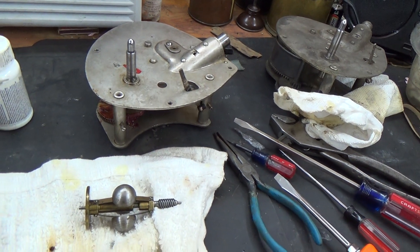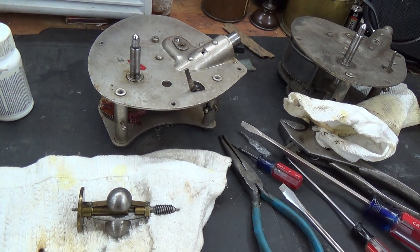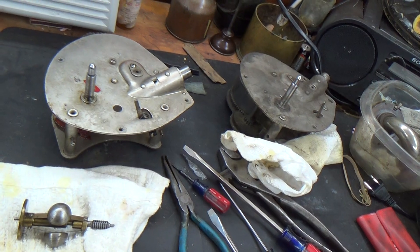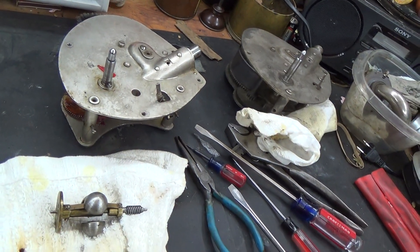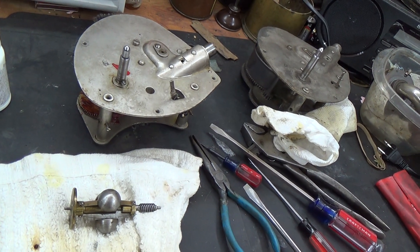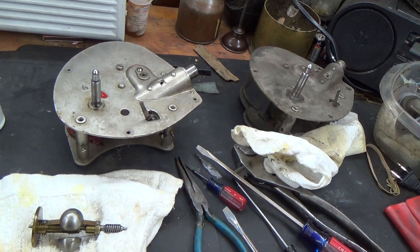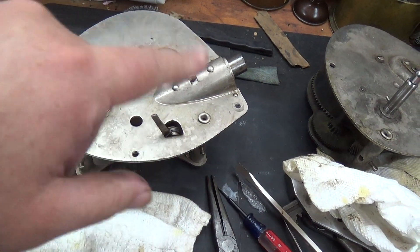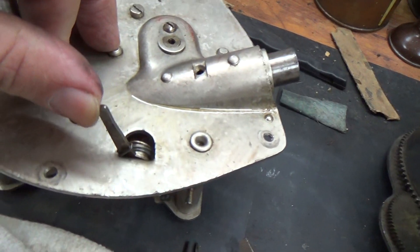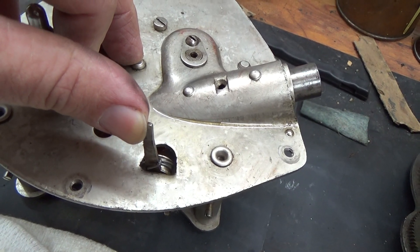If you're just going to display it on a shelf, don't bother — leave it. But if you're going to play records and want it to operate correctly, you need to take it apart, clean it properly, put it all back together with fresh lubrication. As for the lubrication you use: as long as it's a good grade of grease, it doesn't matter much. You can use the original formula — equal parts vaseline and flake graphite — or white grease, molybdenum, whatever you've got. This isn't a high-pressure transmission, so you have more leeway.